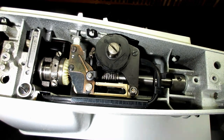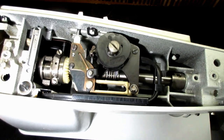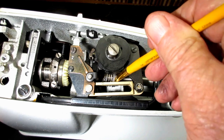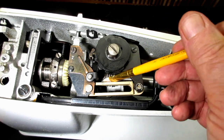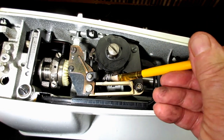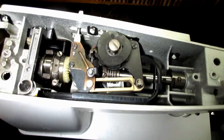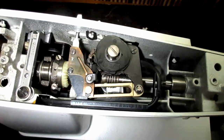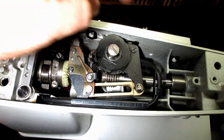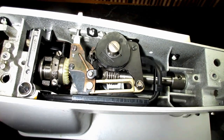Okay. Then I'll turn the hand wheel, and that'll get distributed and transferred. See, look, just one full rotation, it's already moved to the end of the gear here. That's why I tend to put it a little heavier on the hand wheel side of that, because I know it's going to migrate towards the nose end pretty quickly. There we go. And that's just going to get it distributed and transfer it to the gear on the other end there.